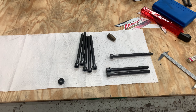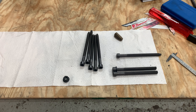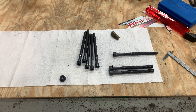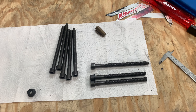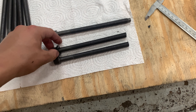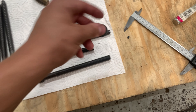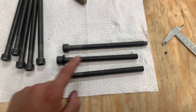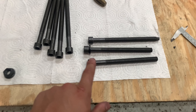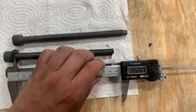We're working on getting the new head bolts set up. Big shout out to Joe for hooking me up with the idea to use these. These are Volkswagen TDI bolts for a PD 150 head. You can find them on the internet pretty easily. Basically they're a little bit too long for the white blocks — the white blocks use 157 millimeter bolts and I think these are 166 or something like that. What Joe told me to do is use the ARP washer — it's three millimeters thick.